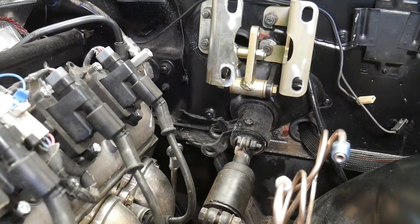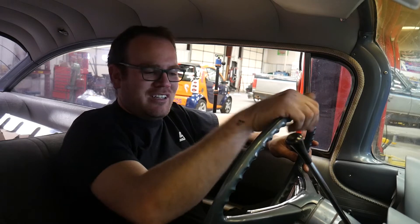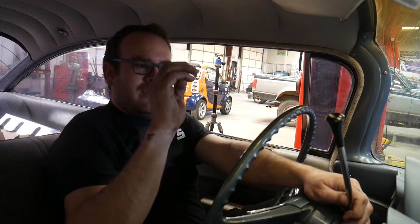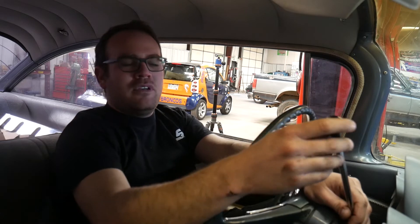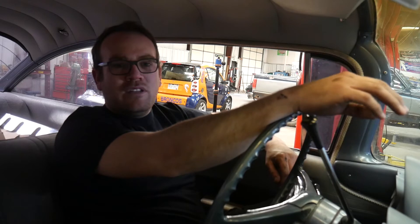Since this is a shifter meant for manual transmission, it's not going to have the detents and safeties like a modern car. We don't want any accidental hitting of the shift lever. So I'm going to use the position further away from the wheel and fix the shifter in that position so it can't be pulled. If someone pulls on it like a modern vehicle, it'll release the shifter from the correct selector under the hood. I'm either going to pin it or weld it under the hood.